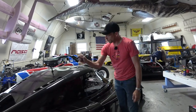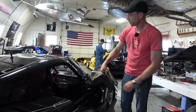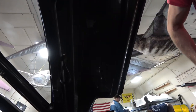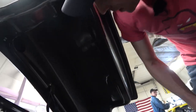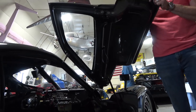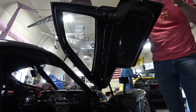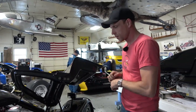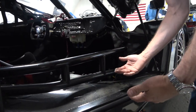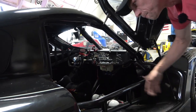So let's take a look in the cockpit. Here's one of the doors — this is a beautiful carbon fiber door. Very lightweight, with polycarbonate side glass. This carbon here has got texture to it, and some of it is smooth, depending on how it came out of the mold. Obviously this is a race car, so there's no sense in trying to make it too perfect — it's to do a job. They're not wasting tons of time to make fit and finish like it's jewelry. But you see the bare carbon here, because if you paint or wrap carbon that just makes it heavier. It's even got weather stripping right here for the door — just goes to show the quality level and engineering of this Riley.